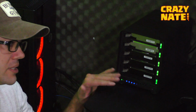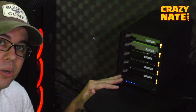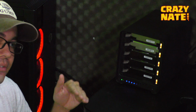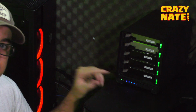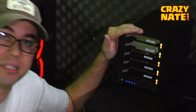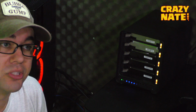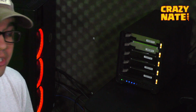And I kind of made the mistake by going cheap and getting the 4 terabyte drives in the first place. So hopefully you watch this video and you learn from my mistakes. And the price it costs for a 12 terabyte hard drive versus a 4 terabyte drive, it's cheaper in the long run just to go get the 12 terabyte drives and stick them in there. And something that massive, 12 terabytes, that's why you want to put it in something like this Drobo where you have redundancy. Because if you put all your storage on one 12 terabyte hard drive and that crashes and you lost it, you're talking like years.